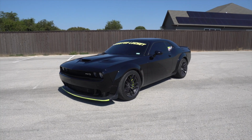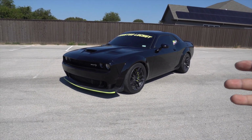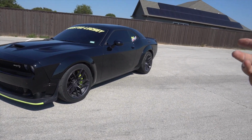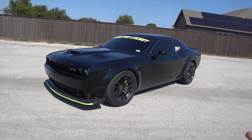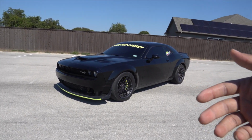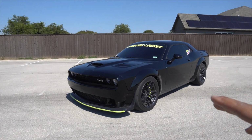So that 667 also was after we had to pull the car off the dyno and let it reset, because we pulled the ABS fuse thinking that, you know, it would do what it's supposed to do, where it doesn't engage the ABS system with the traction off. But we ended up only having to turn traction off and had no other issues. I just know other people will do it, so I was just following standard protocol on that. But we just ran the car with the fuse in, 665 on the stock power.